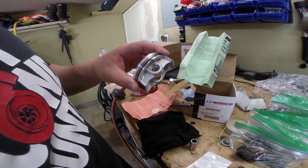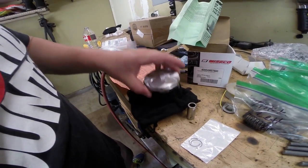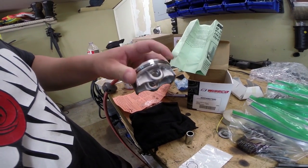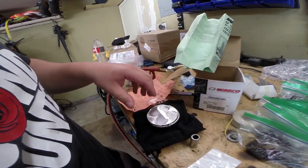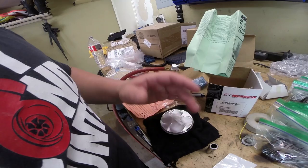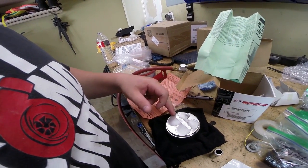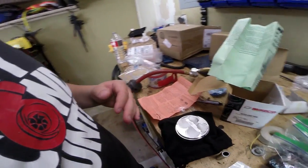So the deal with this is when you put the rings on, put them on in the right order. The top scraper ring is marked with a little N — that lets you know that's the up face. The little oiling rings aren't marked, at least on this engine they're not directional. You want to make sure you offset the slit in the rings by 90 degrees: the bottom oiling ring goes here, the top oiling ring goes here, the scraper ring goes here, and the second oiling ring is here. So there's never a clear way through.